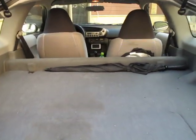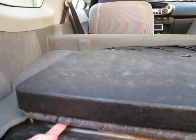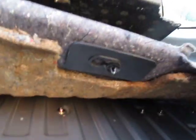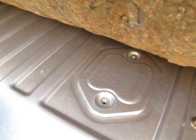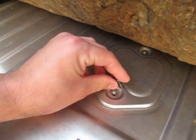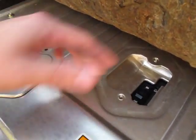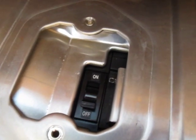I'll show you how to do that. Basically, you just lift the back - your little trunk space here. There are two clips that hold this in. You pop them out right here. You pop that up, just by lifting. I already took the screws out - it had screws here and there. You want to take those two screws out, remove this cover, and there is your battery breaker switch.